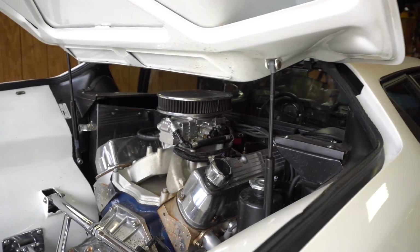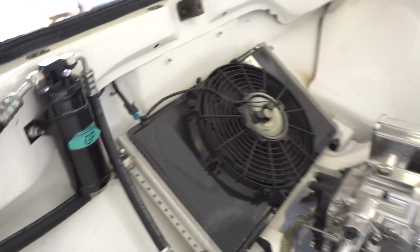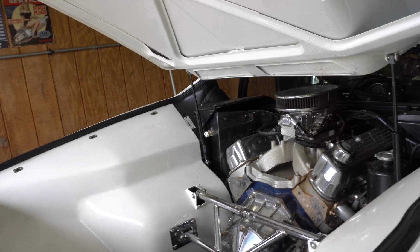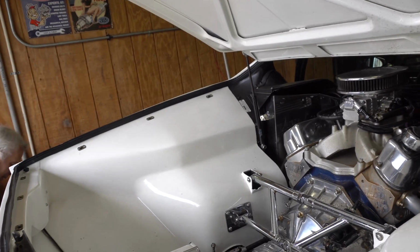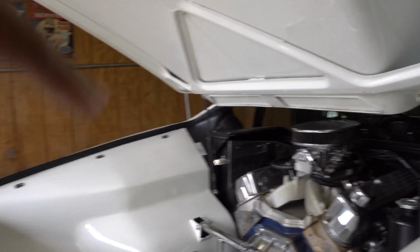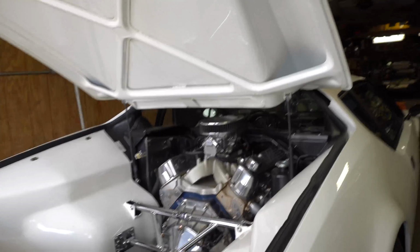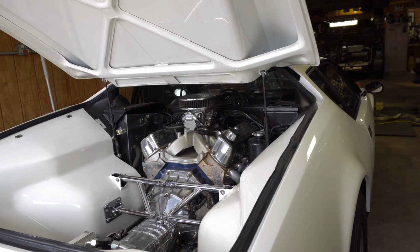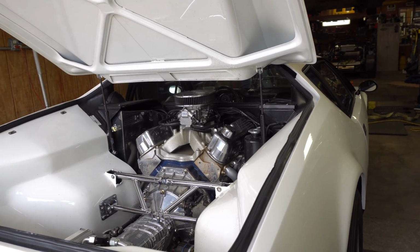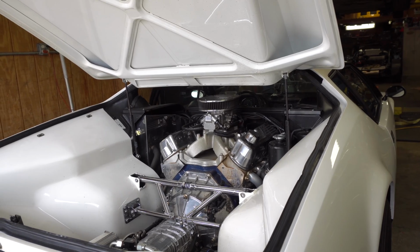Does it have AC? It does. That's cool. This is actually the AC unit. That's a good place to put it. Every once in a while, you'll see them with the pipes coming out through that. What they usually have is the Cobra setup on the exhaust, so the headers come over the top. They crawl over, and they have very different heads on the car. The heads are actually angled differently, and it works. You can see that some of my pipes really come down hard. Because of the angle, these heads are great for the motor, but they didn't create a great header situation.